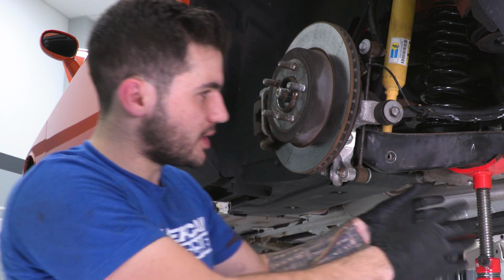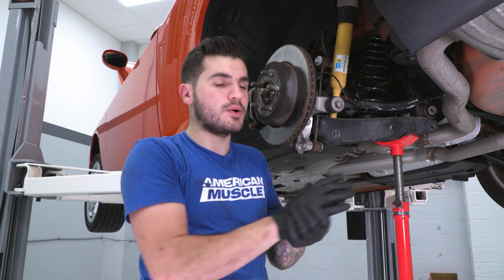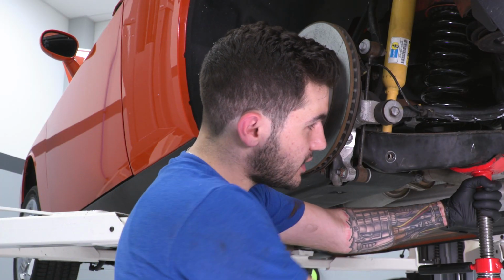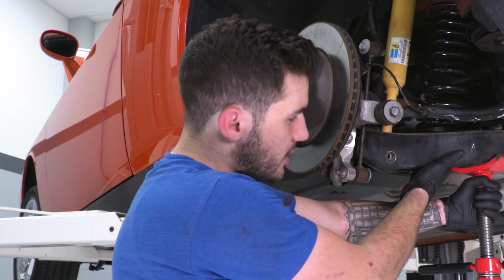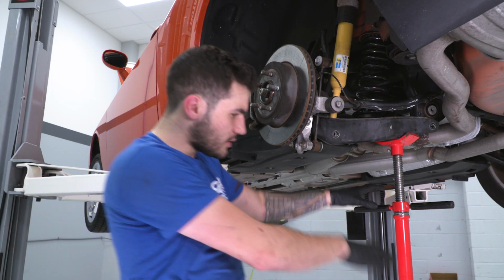As we jack this up, it starts to get to a point of resistance and it pushes the car off of the lift arm. So obviously for safety reasons, we don't want that to happen. So that looks like the problem we're running into now. It starts getting caught, it's going up at an angle, it's starting to pick up off the lift arms. To make things a little easier on us, I'm gonna get rid of this pole jack.